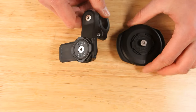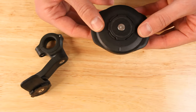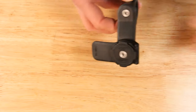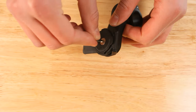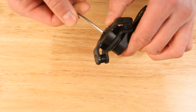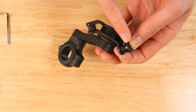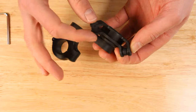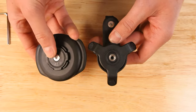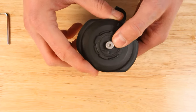We'll go a step further and also install the vibration damper and the wireless charger as well as the OptiMate kit. Since we have the wireless charger we don't need the separate phone mount because it's included in the wireless charger. So simply take off the phone mount. This goes right into the handlebar mount and everything works with the 3mm allen key. The vibration damper has little air cushions that take out most of the vibrations of your bike. Next, the wireless charger goes right on top of the vibration damper.